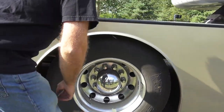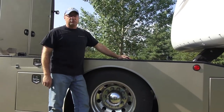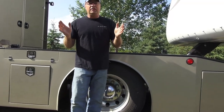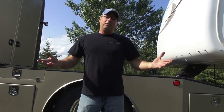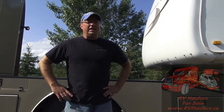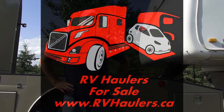The answer is either empty your air tanks to force it to settle, or disconnect from the hitch. It's pretty quick — pull that lever, drive ahead eight to ten inches, let the truck do its settling, and in the morning when you air back up it's a straight run back into that pin and you're ready to go. I'm Greg from RV Haulers — the ET hitch from ET Hitches in Florida is the only hitch you should put on a heavy-duty truck. Thanks for watching.